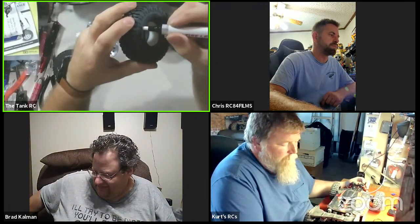I know I get more acceleration, but since the motor on that car, the fighter buggy, is over 20,000, maybe a 17 tooth would run faster than the 19, because it would allow the motor to do more wind up. Try it. So I should probably put a 17 tooth back in there. You can try. I'll get more top end that way. I just run stock on my Tamiyas, so I don't even experiment.